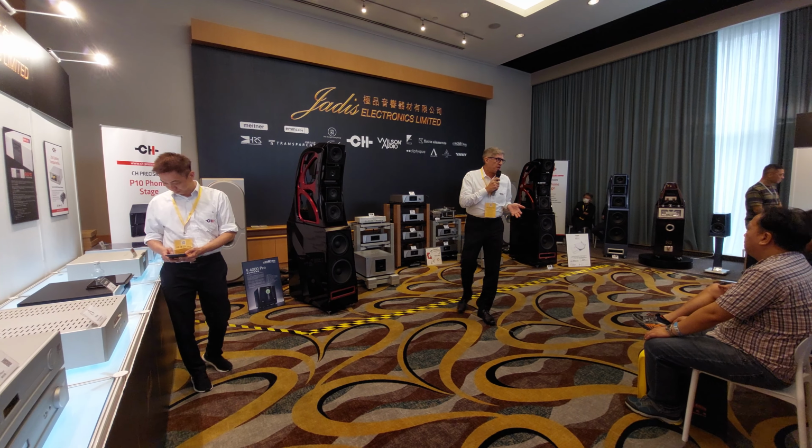There are two reasons to have a shaft spindle attached with the bearing. Because if it's totally floating, it's not stable. There are many air floating turntables, but the air floating is not touching anywhere, so it's not such a stable action. So this is designed to be supported by a one point bearing. And also the static comes through here to the ground, so it's electrically also grounded.